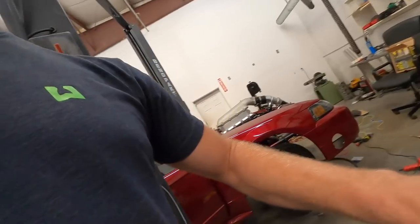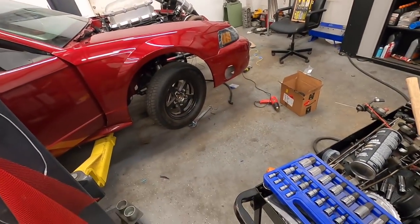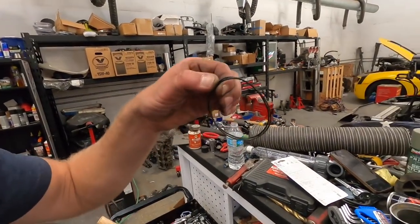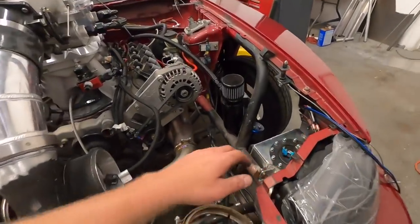When you start working on one thing you find ten other things. The fuel pump — I had to take it apart because the positive lead became unscrewed. I pulled it apart to put the nut back in, only to find out the O-rings are bad. Since I'm running out of time, I bought some heavy-duty silicone to seal it up with the original frayed O-rings. I'm also going to order a second fuel pump just in case one goes bad. It's not the perfect fix but you gotta adapt and overcome.